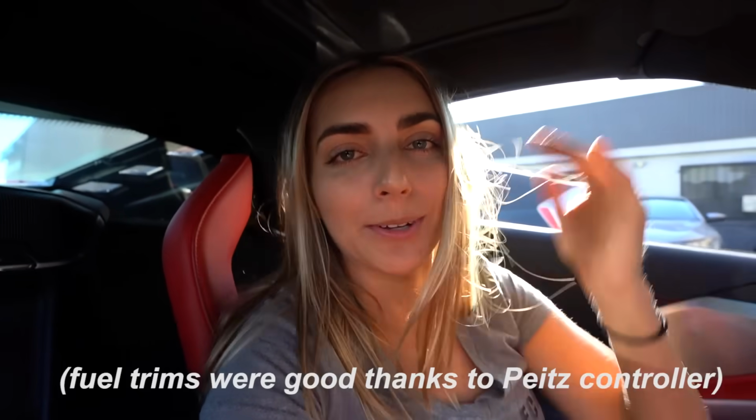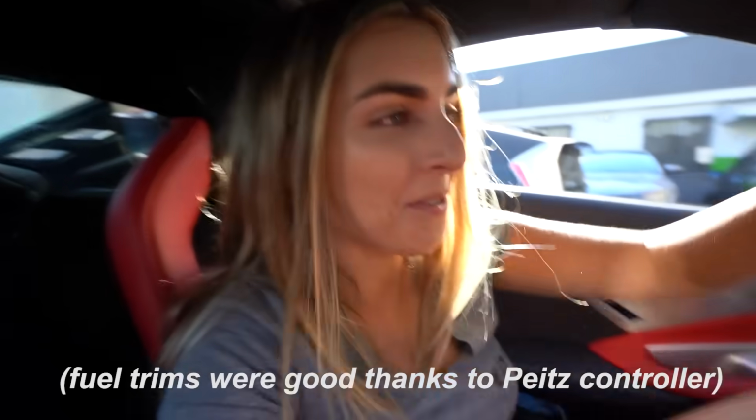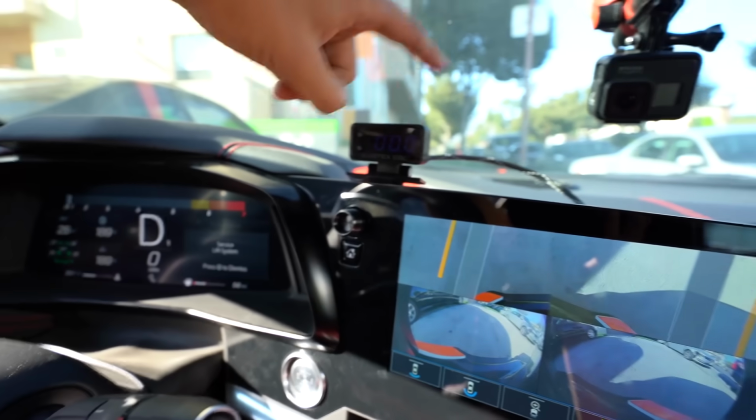Okay, so I called the guys over at Complete Street Performance. They were super helpful. Our meth wasn't working. Our fuel trims looked okay. Everything is okay. We're not running a heavy spring because we're still doing a little bit of R&D to make sure everything works great. I don't know why. The pump wasn't properly communicating with the display, and if it's not talking to the display, it won't work. But I called Complete Street. The guys knew immediately, so let's go out there.